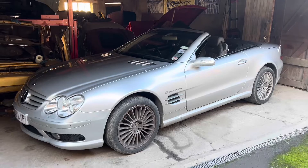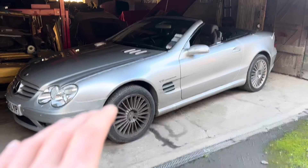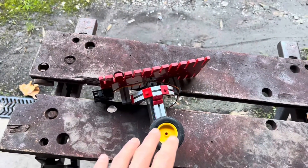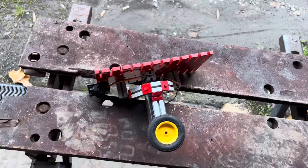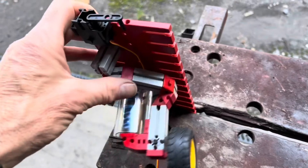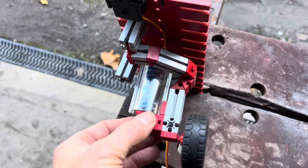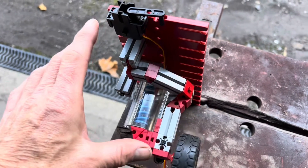There'll be lots of people who know how a standard suspension system works, but for those who don't, I'm going to give a quick rundown using this mock-up of how the ABC system works. Most cars have a control arm hinged at the top attached to the wheel, with a spring attached to the car. As the car goes over a bump the spring absorbs it, and running through the middle of the spring is a shock absorber that damps down that spring motion.